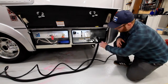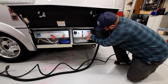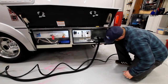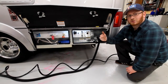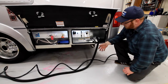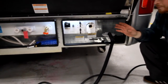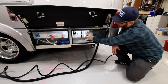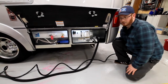After that's done, to help keep things sanitary, you can take off the breather — this is for your Sanicon flush. We're going to open back up the black tank dump and hook our garden hose to this from a faucet or spigot to force water into our black tank. That's going to help clean out the black tank. Once that's going, turn the macerator back on so it helps push out all the water you're putting in. Then turn off your water source, remove the hose, put your plug back on, and go ahead and close the black valve again.